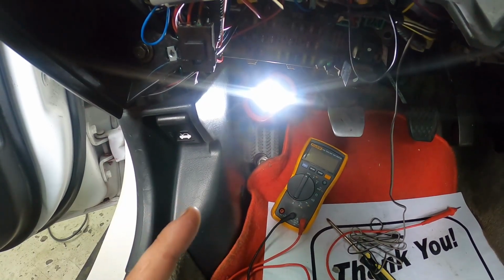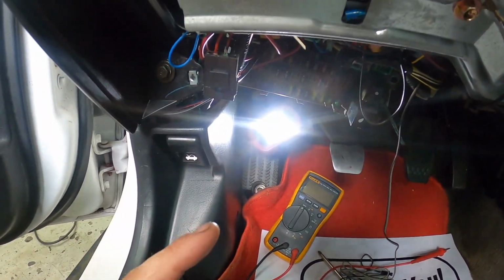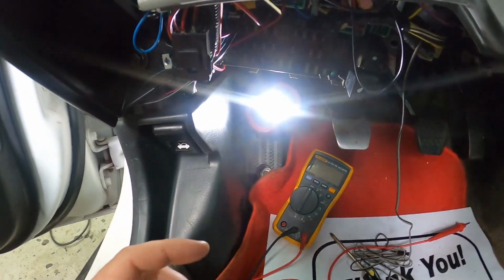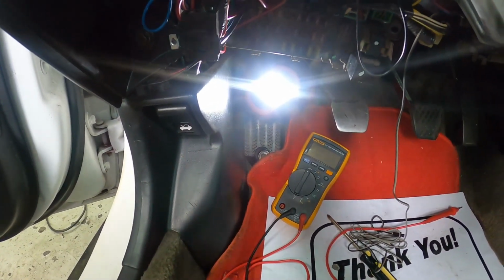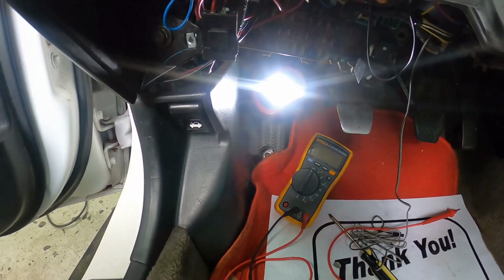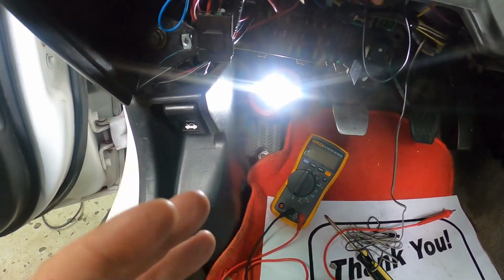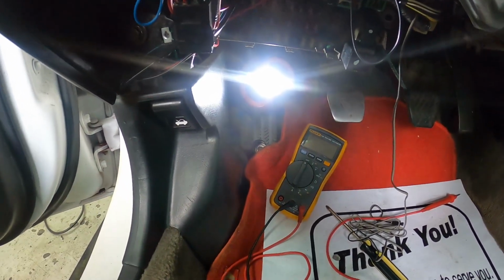And I checked, I've got 12 volts on the fuse. I checked, I have 12 volts on the connector on the strut, and I got 12 volts all the way to the alternator now. So I think it was just a fuse. Why the fuse blew, I don't know. There could still be an underlying problem as to why it blew, but right now it's not blowing.